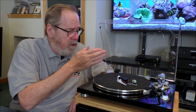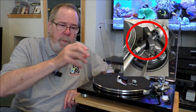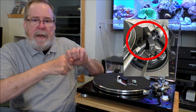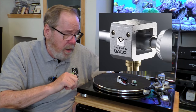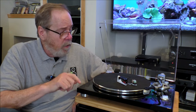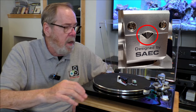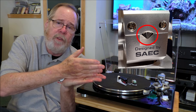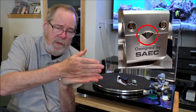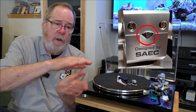Let's talk about the tone arm. The tone arm is really, really interesting. It uses a new kind of bearing — most of us are familiar with a gimbal bearing, which is roller bearings in a housing around an axle or spindle. This uses what's called a knife edge bearing. It was developed by a very famous Japanese tone arm manufacturer, SAEC, and they worked together with TEAC to create this knife edge bearing. I'll be inserting pictures about the bearing here. The interesting thing about the knife edge bearing is it has the least amount of surface area in contact with the bearing race itself.